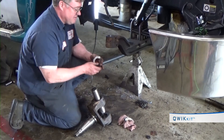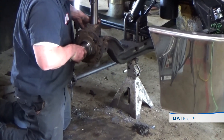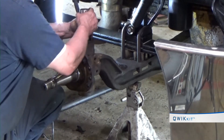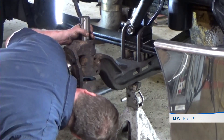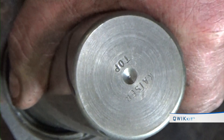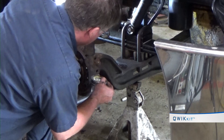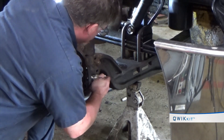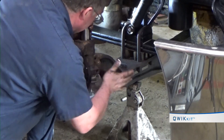Slightly crimp the shims by hand and place them on the pin from under the bore. Place the spindle with pin and shims onto the axle, dropping the pin into the axle at least halfway. As the pin is lowered into the axle, use the word 'TOP' on the pin to assure lock flat alignment. Install the bearing between the axle bore and the bottom spindle bore.